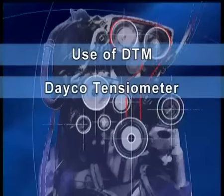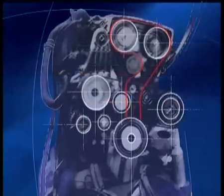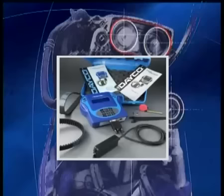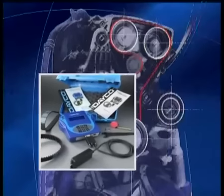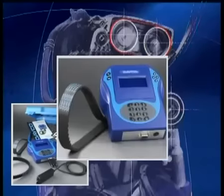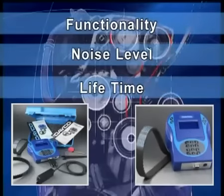Use of DTM, Dayco tensiometer. The DTM is an electronic instrument which acts on the principle of the cord vibrations and is used for a quick and easy measurement of the tension. The correct assembly tension of a synchronous or asynchronous belt determines the functionality, noise level, and lifetime of the system.